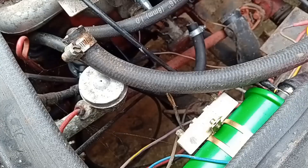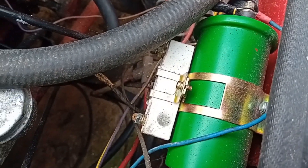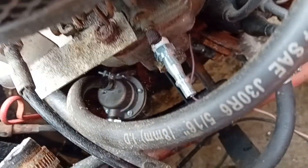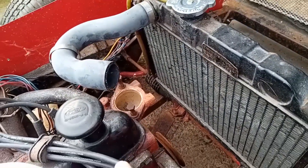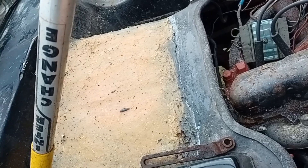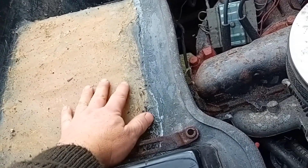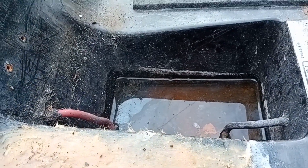Let's go and take a look into the engine bay. We are outside on top of a hill. There's a new ignition coil with ballast resistor, a new fuel pump down there, some new hoses for the radiator, a new radiator cap, and I'm in the process of doing the thermostat housing because it's a bit corroded. I've fiberglassed up where the heater was because that was all cracked and letting in water. I'm not going to have a heater, so I'll need to sand it down and paint it in.